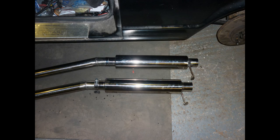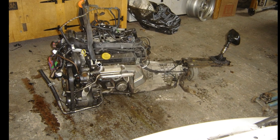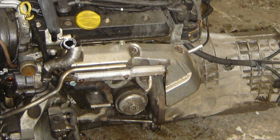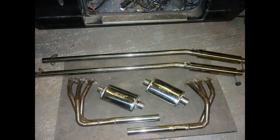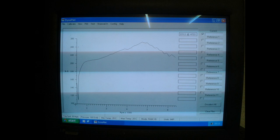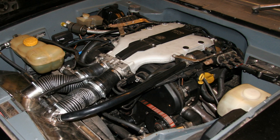It's not just that these headers are very good — what was there before was particularly terrible: two cast iron log manifolds along the side of the head, plus four catalytic converters, two per side. So it went from 211 horsepower. Here's the dyno run from when we had it mapped — between 225 and 230 foot-pounds at about 6,100 RPM, just over 260 horsepower on that dyno. Another dyno said 290 horsepower. I say this car makes about 275 horsepower or thereabouts, so that is simple NA tuning.